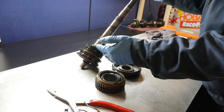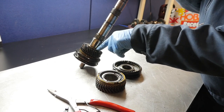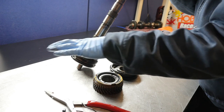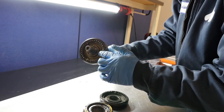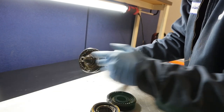The last part is third gear in this assembly. This collar is part of the shaft — do not press against it when you put your bearing splitter on here; you need to press against third gear itself. We need to take that snap ring off and then we'll press third gear and the 3-4 hub off together.